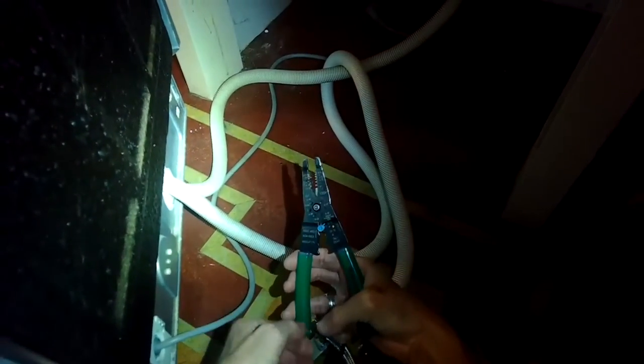Now I'm just stripping back about a quarter inch of the insulation on each of the two wires that bring power to the fill valve, using some wire strippers. I'll twist those to get the wire threads tight. These are the little spade connectors that go on there — you just put the wire inside and then crimp it down using your crimp tool. A lot of wire strippers have a crimp tool built in. I'll put a link for these spade connectors and this wire strip tool in the description below. If you were to buy this same fill valve from Miele, it'd be about $220, but even with these tools added, your total cost will be less than $40.